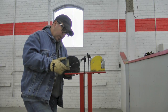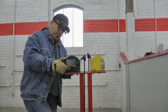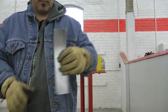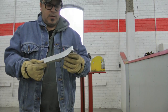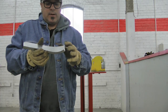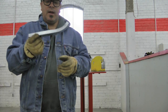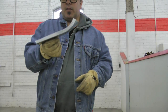So there's multiple angles on this as far as how you can create this. And this is something that just takes a lot of practice. You really manipulate metal. Okay, so now you can see it's starting to really create that curvature. So what you would look at is full bite, full orientation of the metal. Then you go back and take a smaller bite and create more aggressive turns. Also, depending on how many times you move it down the line when you're biting, it creates or reduces the amount of movement as well. So there's multiple ways of controlling how this bend is. Okay, I already know where I need to be on this, so I'm gonna make one more pass on this and then I'll double check it on the car.